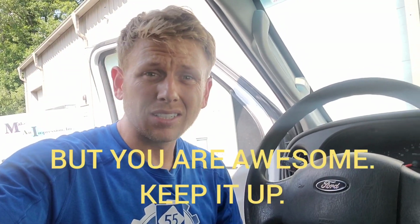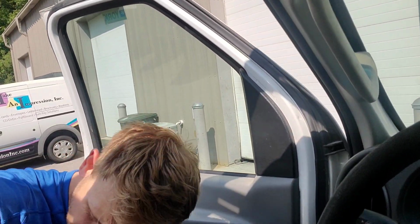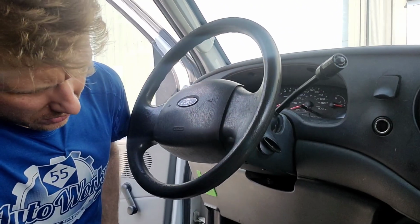Fleet cars suck. So, got an E250. What year is this? Oh, '06 with a 4.6. Had a cylinder 7 misfire. Complaints were shaking at idle, also shaking when braking. That's front rotors that are warped. These are the two-wheel drive bearings in the rotors type. That's going to happen in the shop tomorrow, I think. But that's complaint number 2. This is number 1. Cylinder 7 misfire.